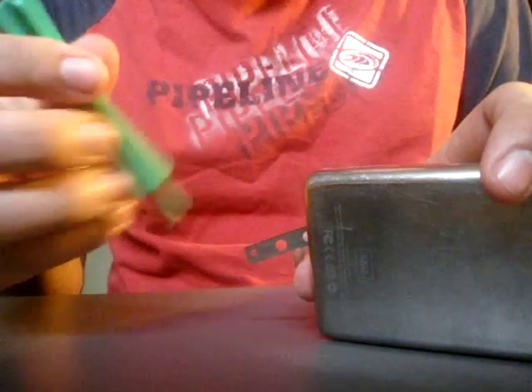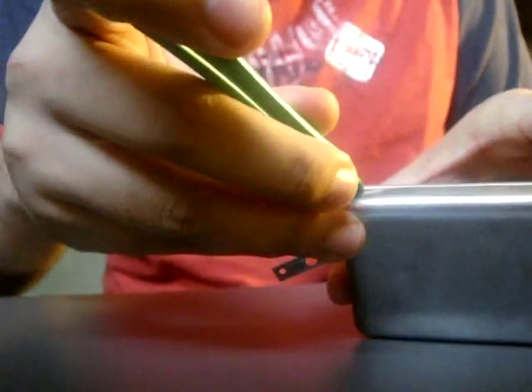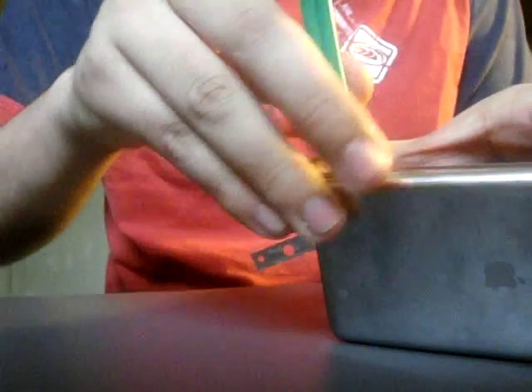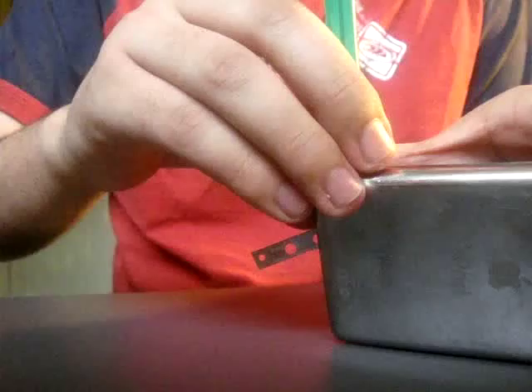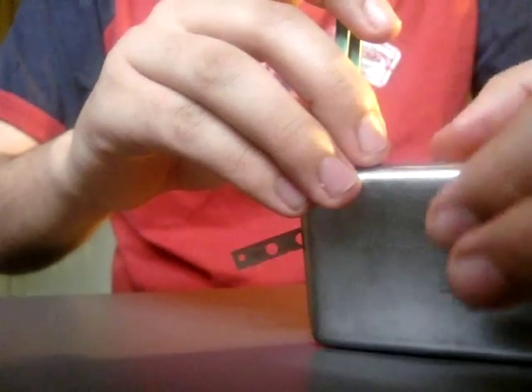Let that go and start here at the corner, then you work it. Right here, right at the very bottom where I just stopped, there's another clip. You hold it up and you push in, and then out. But you have to keep the iPod straight up — don't hold it like this because then you'll just be working against yourself.